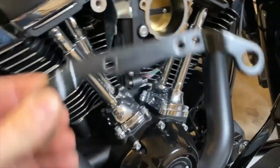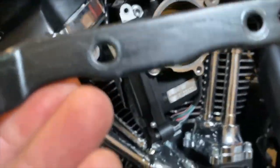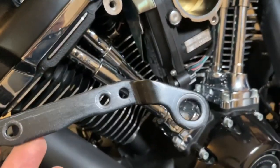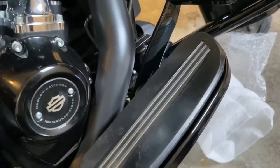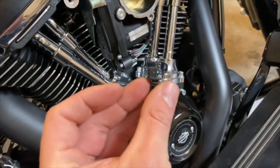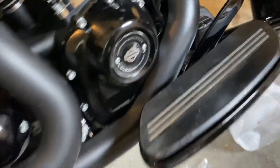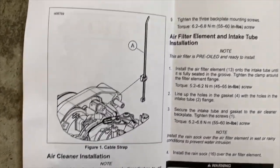After you do that you have this little bracket here — this bracket is usually here — so you remove that. And this throttle body wire which is right there is usually held onto the bracket with a little zap strap, so I pulled that off. That was the zap strap that held the throttle body wire on.